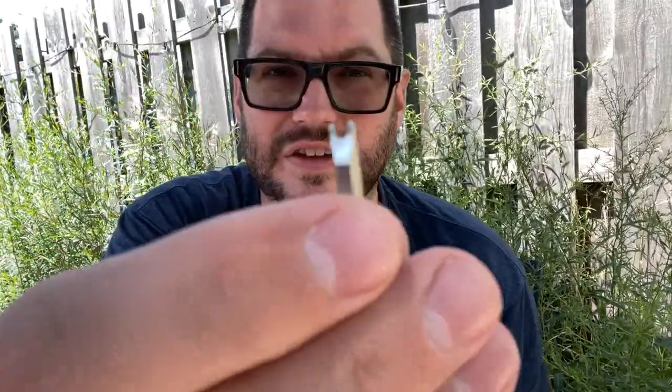I used a #1 style Phillips head bit to get this, and that's the one that's pretty easy to get. Most people have that. The one that is not so common is this guy on here, the iFixit bit number 6 that has the 2 prongs. That's because there are 2 screws that come out that do this.